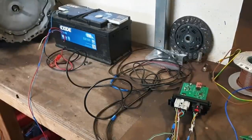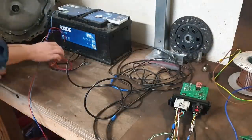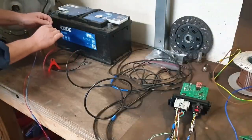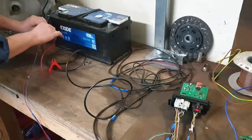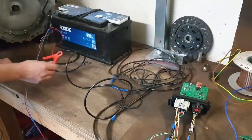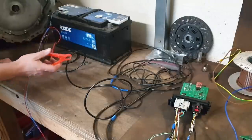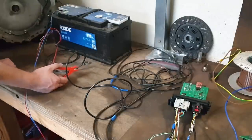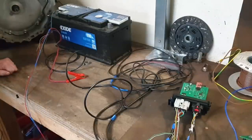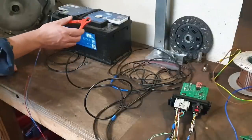Now that we have verified that we've got no problems in our 12 volt supply, we can now safely go ahead and connect up our 12 volt battery directly to our inverter. Now, it'd be no harm at all to have a little 5 or a 10 amp fuse in here, but keep in mind, folks, that a fuse will not protect your VCU or your inverter. It's there to protect the wiring only, hence our little light bulb